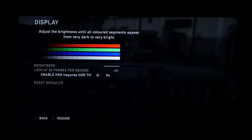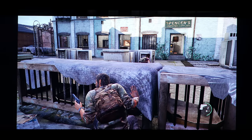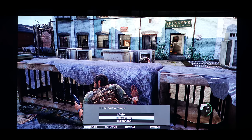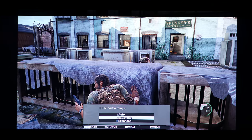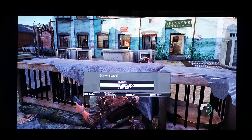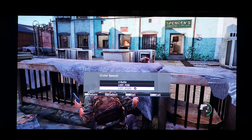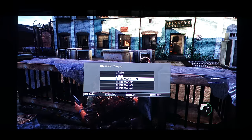In the game settings, I turn HDR off — and the projector goes, 'No, don't do that to me, I like HDR, I want HDR.' But I said too bad, I've got to make a video for my subscribers. Once again, the video range is totally up to you — Normal, Expanded, whatever your preference is. Now in the color space, the 709 and 2020 have swapped roles. 2020 is blowing out in the reds, and 709 is doing a far better job, but still looks pale compared to 2020 with HDR. With any SDR content, you cannot have HDR mode selected at all from 1 to 4 — it doesn't matter, it's too dark.